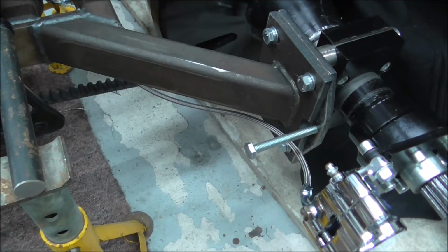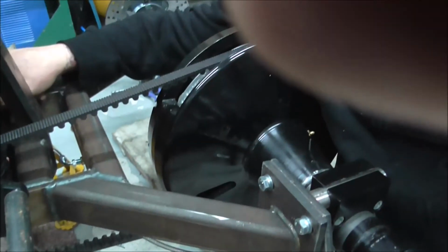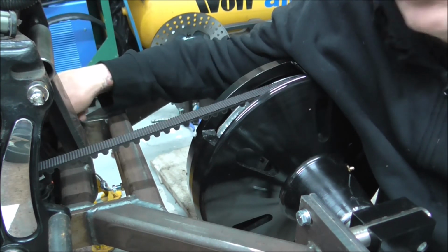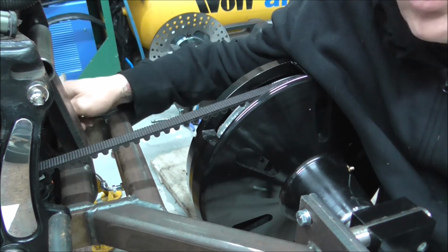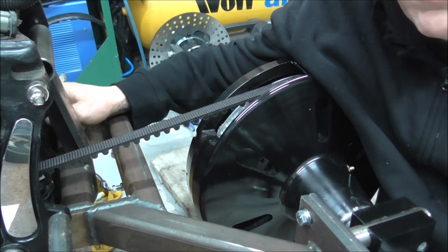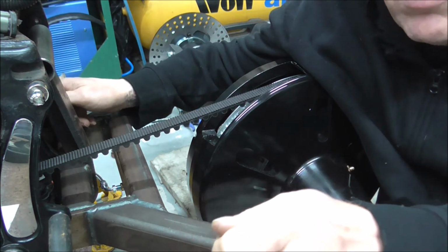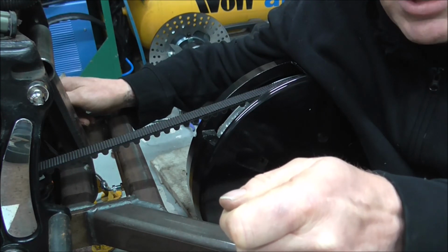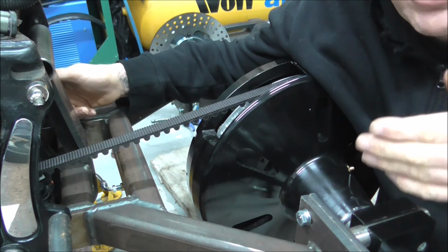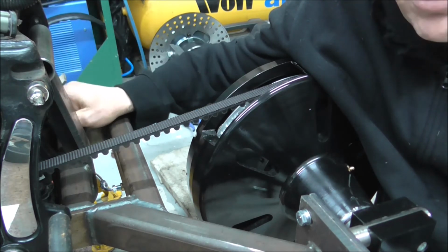Then, like on this bit where it goes over the swing arm, you can loosen this off and just lift up a bit. You probably still can't see. Yeah, maybe you can. In here, where I've got it looping up over the swing arm pivot, one is the radius, which is fine, it's not too tight, but when I was explaining how I'll move the bit over slightly when I eventually tighten it up, it puts it away from the swing arm so it doesn't chafe against the swing arm and possibly over time wear through. So that's another thing you've got to think about.